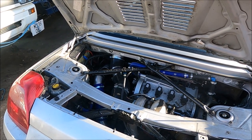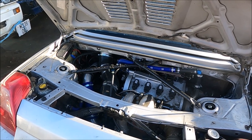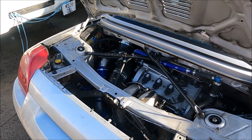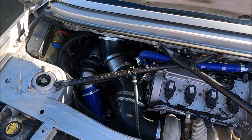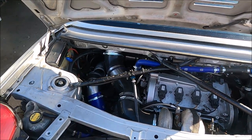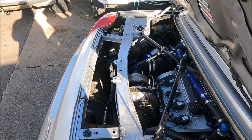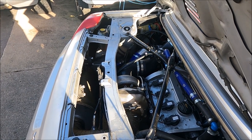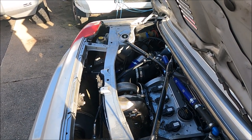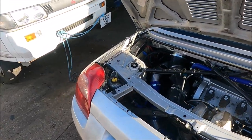So for the first time in maybe over 20 years, I'm going to run a blow-off valve, a dump valve, whatever you want to call it. Normally it's the first thing I remove. But in this case it's actually an issue - thanks to the gigantic turbo it wants to spike way too much. A little spike is a given, but when this turbo wants to give way more than what it's given, the spike is just too massive and it goes bananas and pops things off.